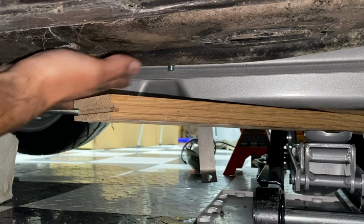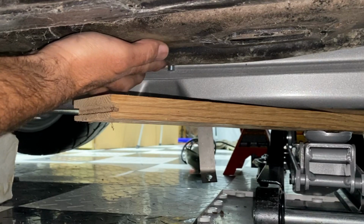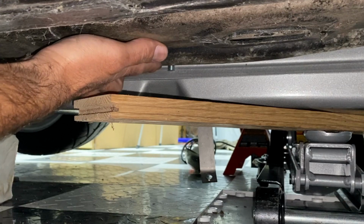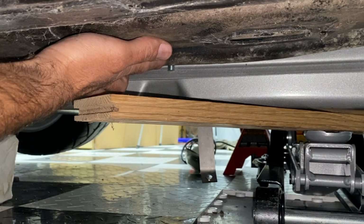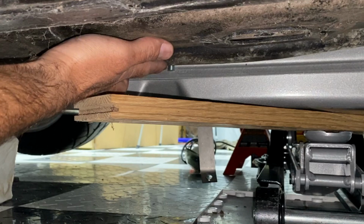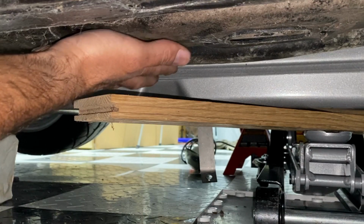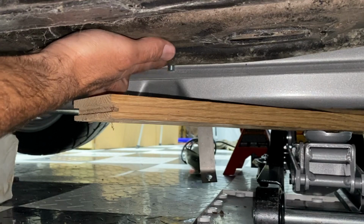Now, you have these coolant lines here. And if the T-bolts that you get from Rodney Dickman's aren't long enough, you may have to get another piece of, I believe these were 3/8 is the size. And what I did is I extended them another 1.5 inches. So that way it clears that. But I'll leave it up to you, because I couldn't move my lines that much out of the way. So you may have to extend them if not.